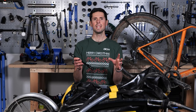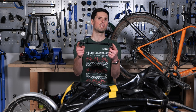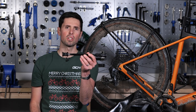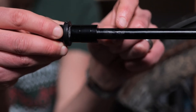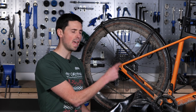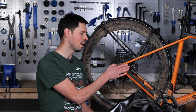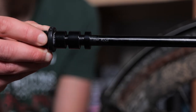If you're planning on mounting any accessory or perhaps this trailer onto your bike, you're going to need to use the correct axle adapter, which is normally supplied with your accessory. You have to choose the correct diameter axle and make sure the thread pitch on the end matches up to that of your bike. To find out, it's simply a case of taking the axle out of the back of your bike — it normally has it stamped on. Another point to consider is that your bike needs to have an open end on both sides of the frame. If your bike has an enclosed end here, then a solution such as this isn't necessarily going to work or be suitable for your bike.